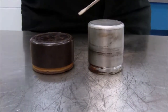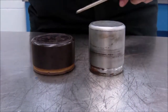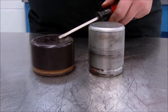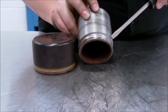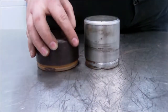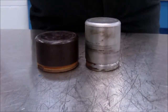These are examples of the different types of pistons found in calipers. They really vary in size depending on what the engineer decides is needed for the vehicle. Not only does the size vary, but the material varies as well. For example, this piston is made out of metal, while this piston is made out of plastic, which is called phenolic. There are also spots for the square cut O-ring, which we'll talk about later. Pistons can get damaged easily — as you can see, this piston was chipped, possibly because it was plastic or due to an application gone bad. The piston is really the most important part of the caliper.